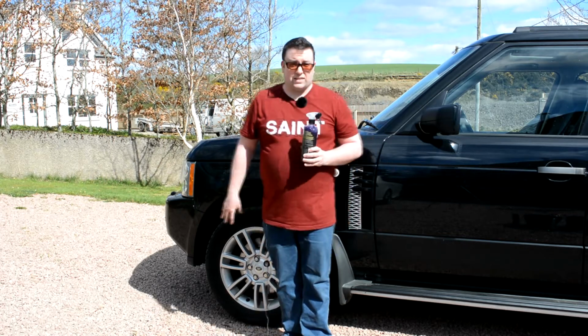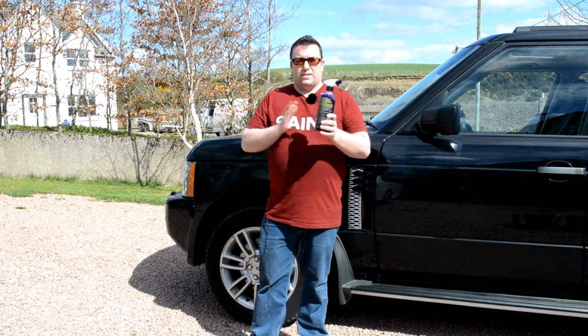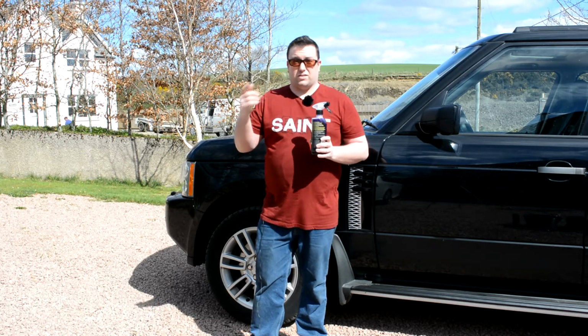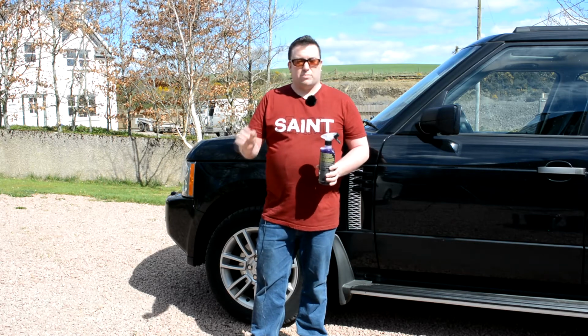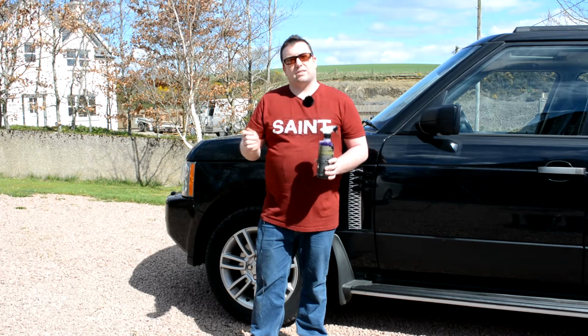Basically, your brake discs are metal. Your brake pads generally contain a small amount of metal. That friction is going to shave off some of that metal. As you know, your brake discs wear down. That metal has to go somewhere, and it usually sticks to your wheels. Now, you don't often see it in a great deal. It's not very visible because it's very, very small, but you might find it looks like brake dust, but it can't be removed with regular wheel cleaners.